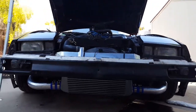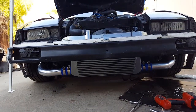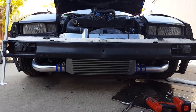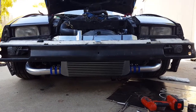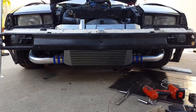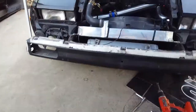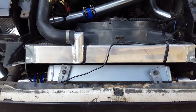The core I used is 18.5 x 9.25 x 2.75 and the inlet/outlet is 2.25 inches. Some of you might think it's pretty small but I have modest horsepower goals, so obviously if you want a bigger one, you'd get a bigger one. This one's actually pretty decent sized though — if you look at my 3-row radiator, it's about as thick as it. So that'll definitely work for me.